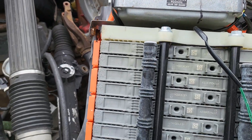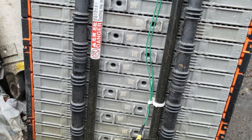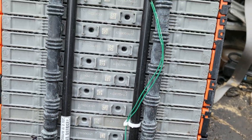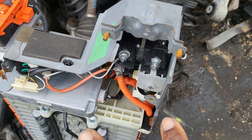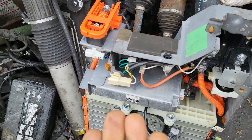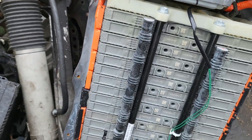The battery is located behind the driver, at the trunk area — it depends on the car. Be careful and do not touch those areas with bare hands. You can get electrocuted right away. Anything on a hybrid car with orange wiring requires certified insulated gloves. Use the gloves and work on it.